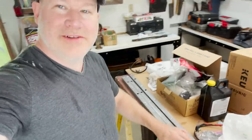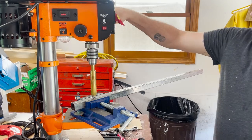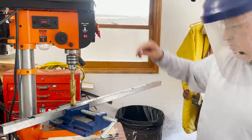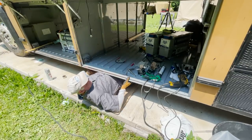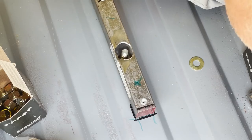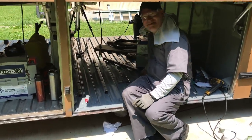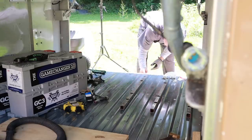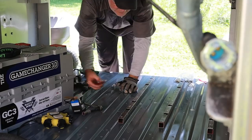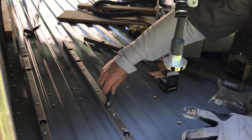In order to get access to put a ratchet into these holes, we had to get a giant drill bit. To safely use it, I put on a long sleeve shirt because it's flinging hot metal everywhere. Dad's underneath the bus. I'm passing him the bolts. We're putting a little bit of SikaFlex between the washer and the bus floor, and on top I'm putting some Loctite, a washer, and a nylon lock nut, then securing them in place.